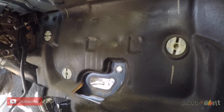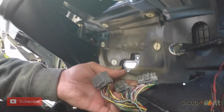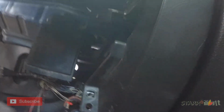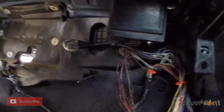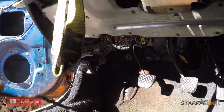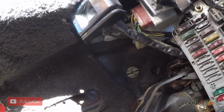which I'm gonna either oval out so that I can put a different boot in there and seal it all up. And then my ECU wires are still bare because I'm not sure where I wanna mount my ECU. I don't really wanna put it into the stock place. I might mount it up here off a plate or something. And then on this side, I'm gonna have to probably extend these two plugs so that they can reach that hole, because I have to go up and over all of that.